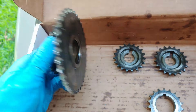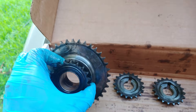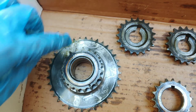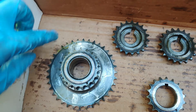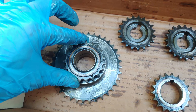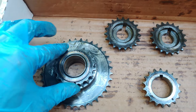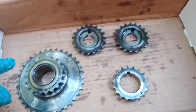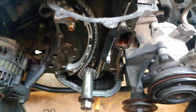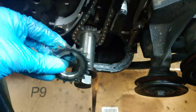As you can see, you have the marks and these dimples — dimple, dimple, dimple, dimple — on the sprockets. This is the idler sprocket; it doesn't really go a certain way. On this one you have a marking here and also here, because on the back this is where the lower timing chain goes, and on the front smaller section this is what drives the chain for the upper intake and exhaust.